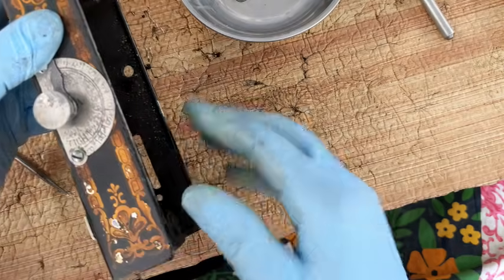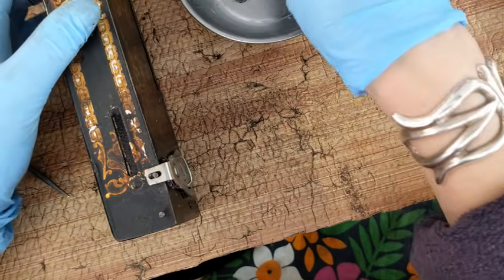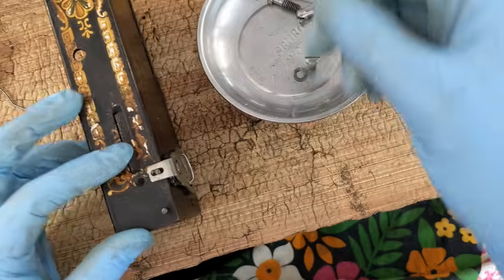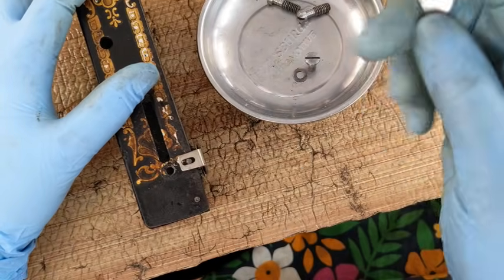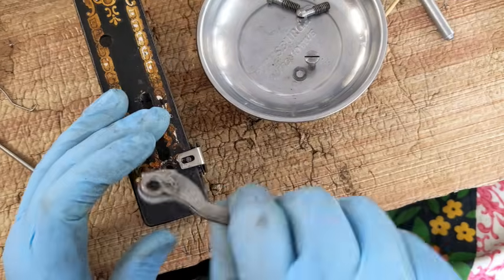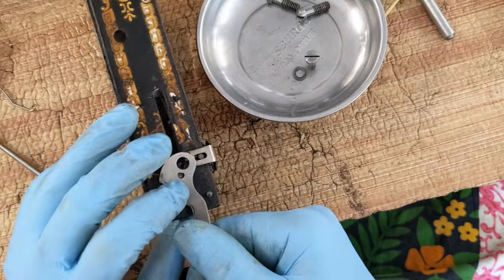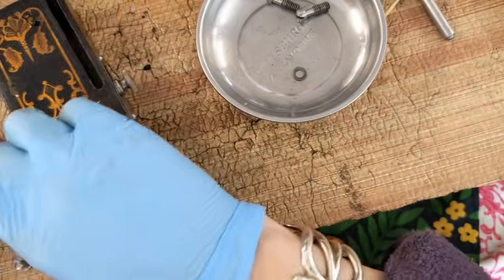Okay. I'm going to go ahead and put the lifter lever on because I have that in the same little bin of parts right here. And there's a little piece in the casting right here that sticks out. The curved side of this is going to go up against that piece of the casting. And there's this little molded part that kind of sticks out. That goes up against the piece here, okay? And I have a screw. Oopsie, hang on a second. I've got a washer here.